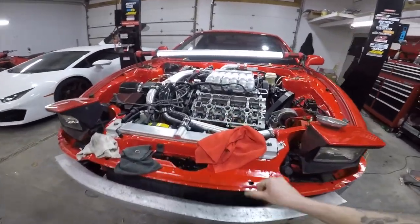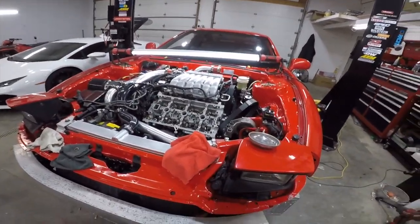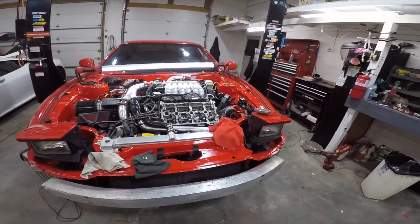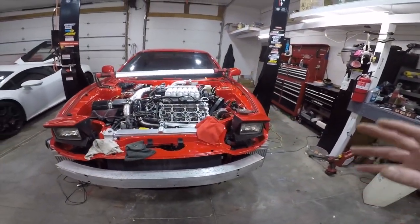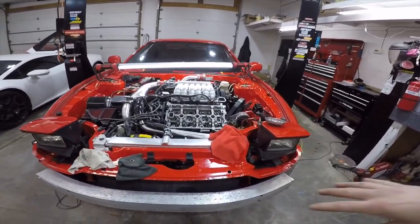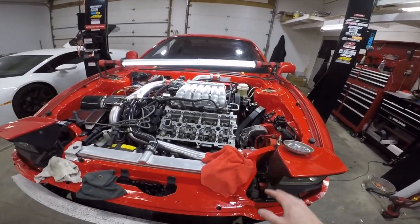I don't even know what I'm doing. I should have just did it. When I found out that the cams were in backwards, I should have did it. When I found out that the oil pump was leaking, I should have did it. Adrian took off work this whole week, so hopefully we can get this out and at least all broke down in a couple days. All I gotta do is send the heads off and the block off and have them go over everything. I want them to pressure test everything.